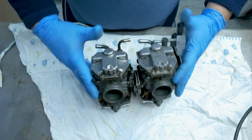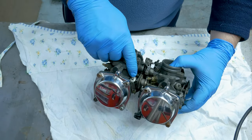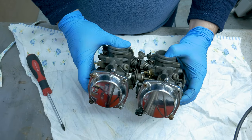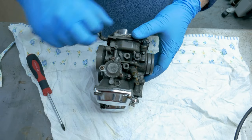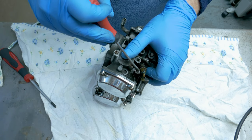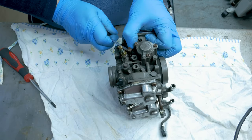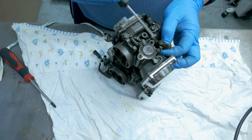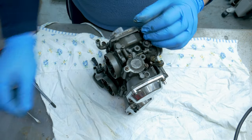This was quite tough. This is connected with the choke system. I'm going to undo this little bolt right here on the choke and see if that helps it slide off. No. So this rusty e-clip - we're going to take that off next because it's rusted quite badly. There you go. Press this washer off and then there's a spring behind it. The spring doesn't want to let go because it's rusted on quite badly.